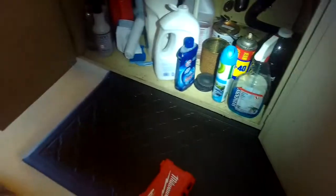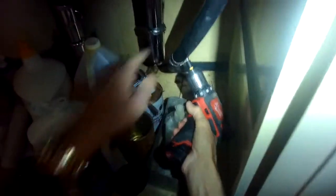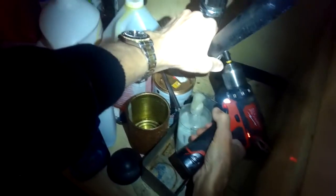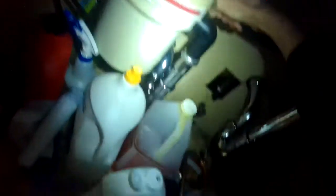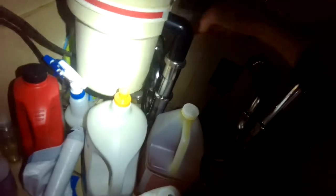On some models you might just hear it as a beeping and the cycle will stop. I would try that little white thing first that we saw in the beginning of the video. If that doesn't work, then you can go to the drain line like we're doing here and see if there might be something stuck. I really like to disconnect the drain line from the garbage disposal, put it in a bucket, and then turn on the drain to see if maybe something will pop out.